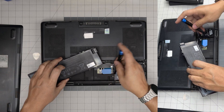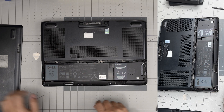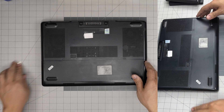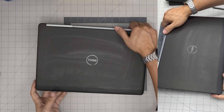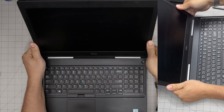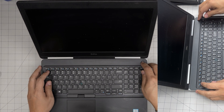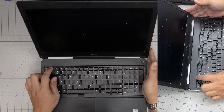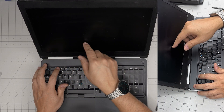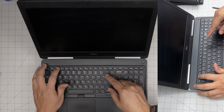Once done, grab the battery, put the bottom end by the speaker and push it down. Grab the cover with an offset position, push it back, and that's it. This is how you can upgrade, add, or remove RAM for your Dell Precision 7520. When you power on it might take around 30 seconds before anything shows — just make sure you use the correct charger.